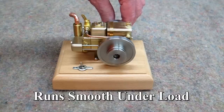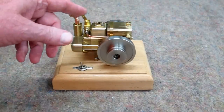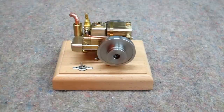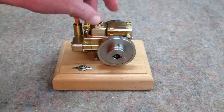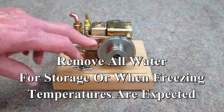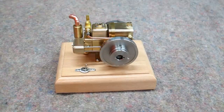This little engine wants to run with the load. This does get hot, but the water jacket is still good. The body of the engine where the cylinder runs is good. The head and the rocker cover gets hot. This idle is really nice, and if you put a load on it, it steadies out nicely.